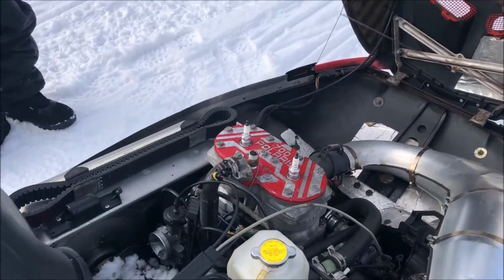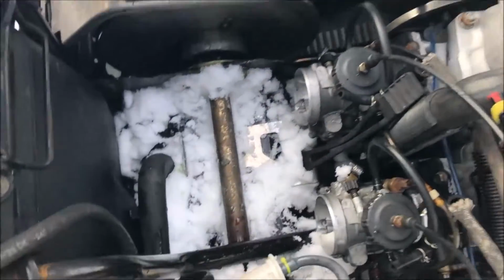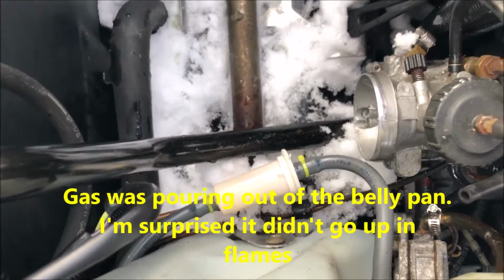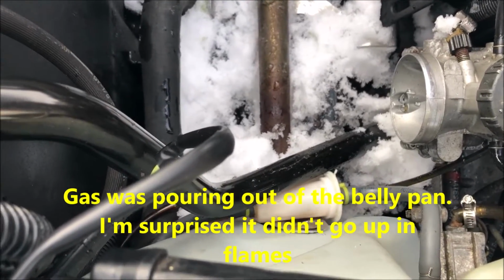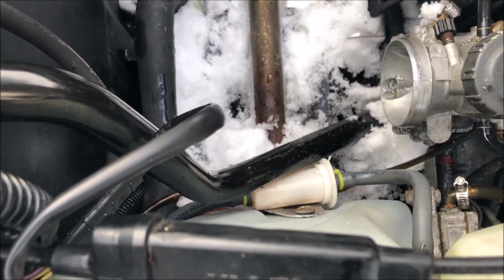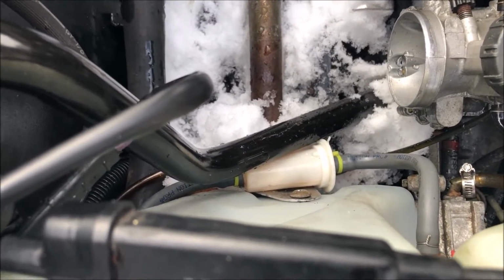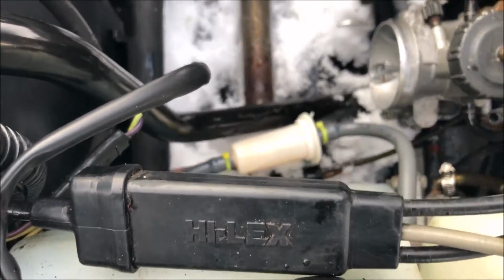All right, so it looks like we are towing it back, not because of the engine rebuild. The engine's running fine. We discovered a pretty good sized fuel leak. What's going on is when the steering post is going to the left, it's coming in contact with the filter, and it's actually separated the hat on it. It's causing a leak.